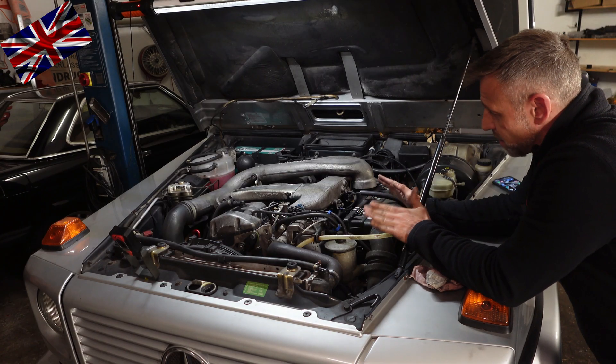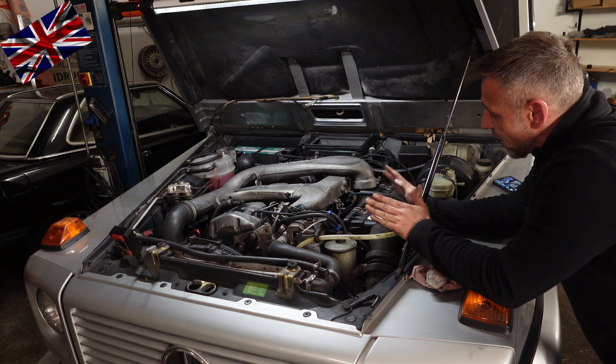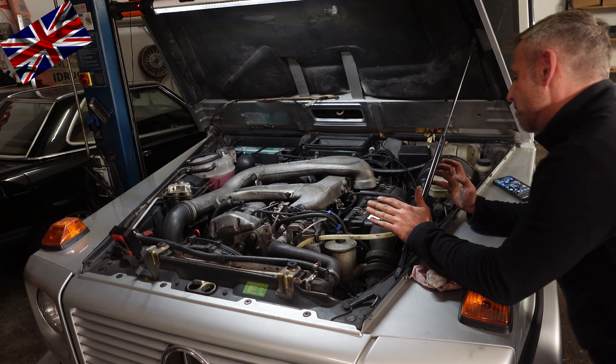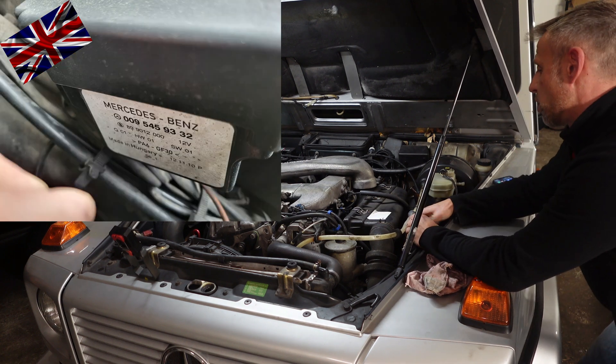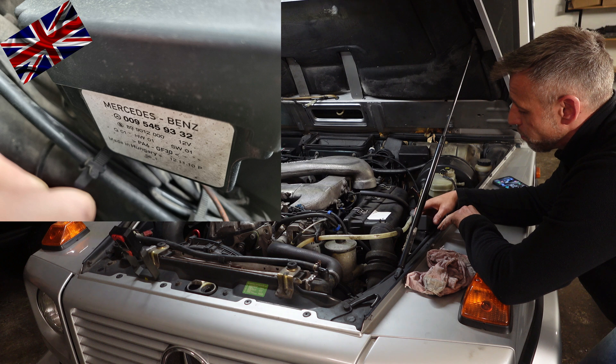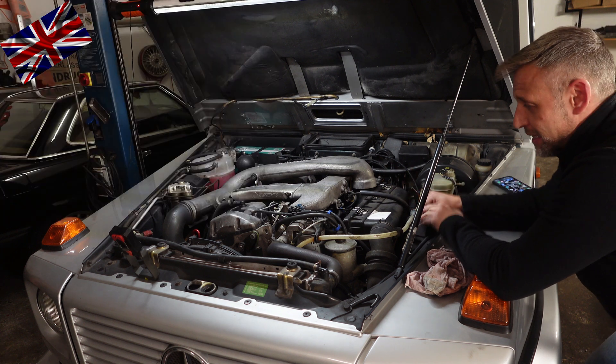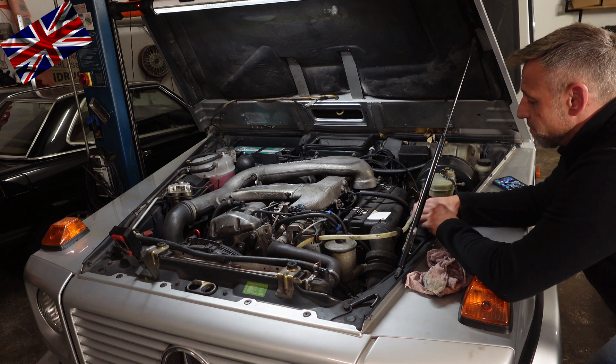In this case this component has no extra fuse anymore - a common failure item, but never mind, we get it done. I need to disassemble and remove the intake assembly to reach the glow plugs and check if they are working.